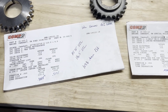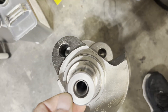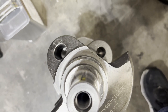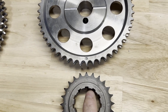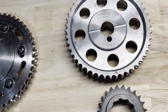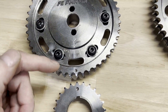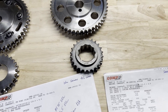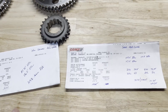The second reason is: here's your keyway on your crank — everything has a manufacturing tolerance to it. Who says the keyway couldn't be out of spec a little bit? Who says that your timing set's keyway, or the way they etch or engrave the marks, isn't incorrect? If you're using an adjustable timing set, you want to make sure everything is correct. It's not always the cam's fault — sometimes it's a tolerance stack between the crank, the cam, and the timing set. So yes, you should always degree your cam to make sure everything is right.